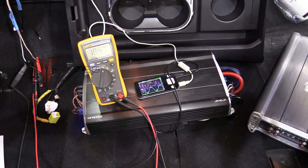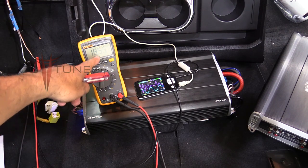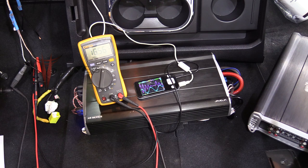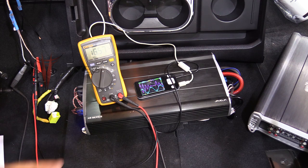I've got my target voltage of about 18.5 volts. Looking at the oscilloscope, you can see the signal is beginning to clip at 18.5 volts—that means when the head unit is turned all the way up to 50, the signal will start to distort and damage your speakers. We like to set it at 18.5 with just a little distortion for two reasons: we're using a static test tone versus dynamic music, and the CD signal quality is higher than Bluetooth or XM radio. Volume 50 is your max for CD; for XM on these Tundras you can go to about 52 or 54.